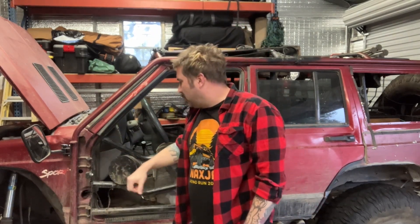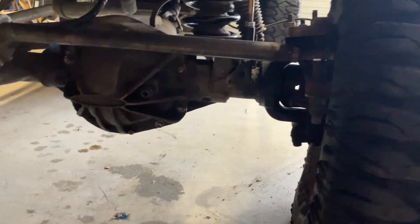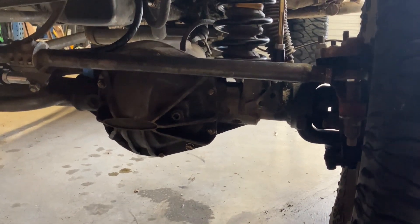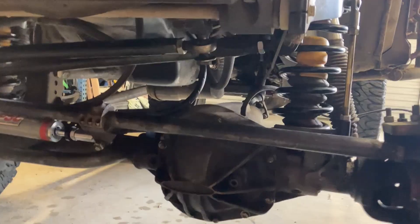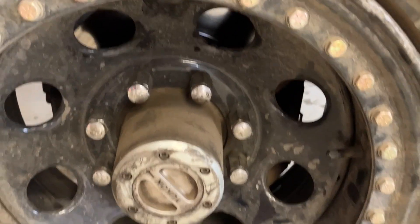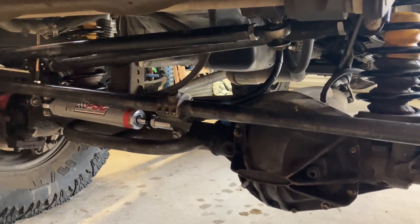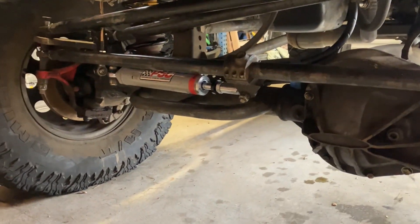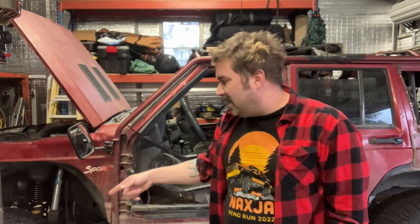I'm just using cheap waterproof marine speakers in the speaker cans and they're welded straight to the tube. Now let's get to the fun stuff — it's got one-tons under it, a Dana 60 front from a Ford F-350, 35-spline chromoly Yukon shafts, Yukon super joints, Yukon hardcore locking hubs. We've got some Battle Born beadlocks in 38-inch Walmart tires — the Patagonias, the Patagucci's. I know a lot of guys love those. Inch-and-a-half DOM 250 wall. Got PSC hydro assist with a big-bore XJ/TJ box with an inch-and-three-quarter RAM custom length, like seven and a half inches. Got high steer on this thing as well.